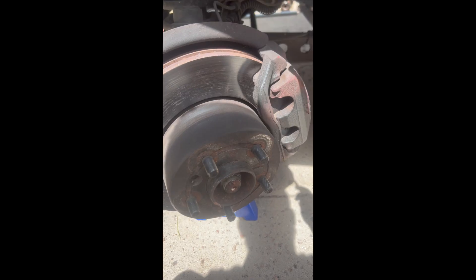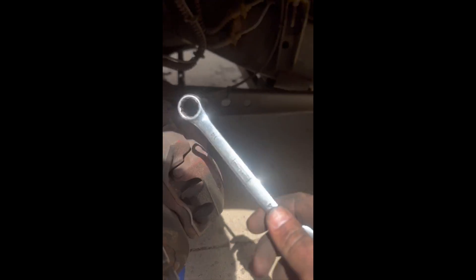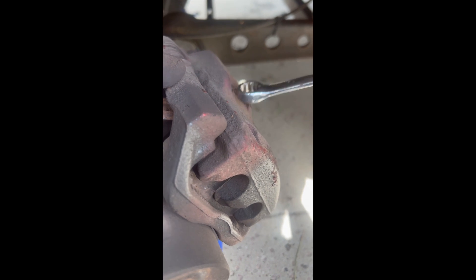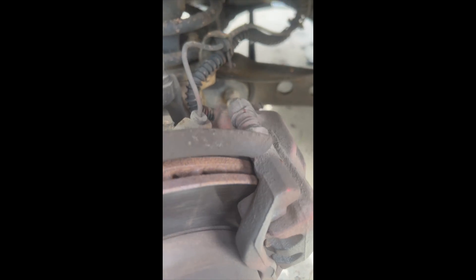I usually like to do them one side at a time. I already did the back. When you get here, you're going to take these off — this is brakes — you take these off so you can get your caliper off, and then your caliper bracket behind that. When you get up top, these are 14s, and then the caliper brackets are 19s. They look like a special bolt, but really it's just 12-point. Same thing with the back — the back is 12s and 13s. Remember, these are 14s and 19s.